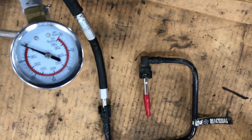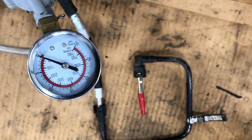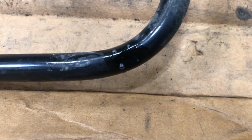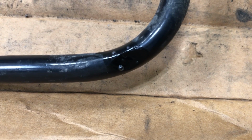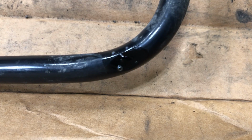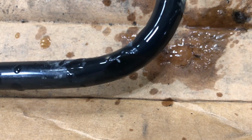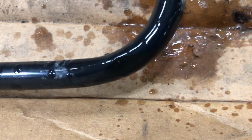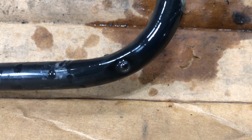At that point, I hooked up the air tester, and it's bouncing around, but it's really within the allowable range under pressure. But the evap system operates on this vehicle under a vacuum when it's detecting small evap leaks with the car sitting for a couple hours or more. So the downside to having an evap air tester is that you're not testing the vehicle under the same conditions in which it's being monitored by the car's computer. That's a big downside to the evap tester that shops use.